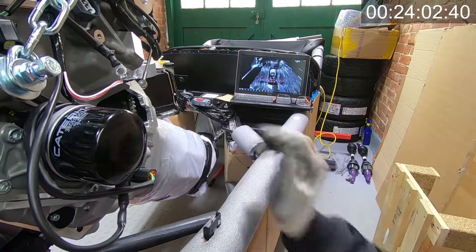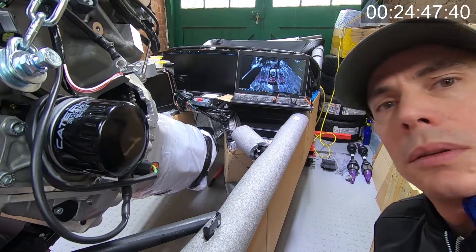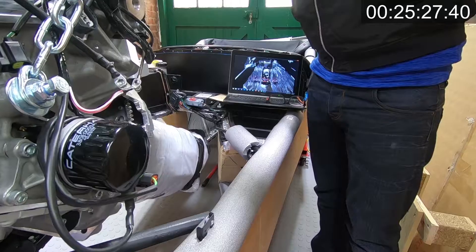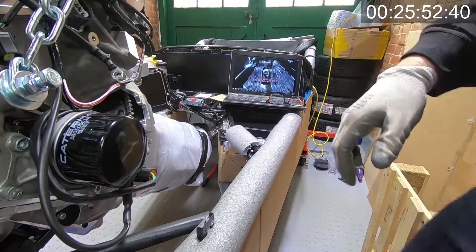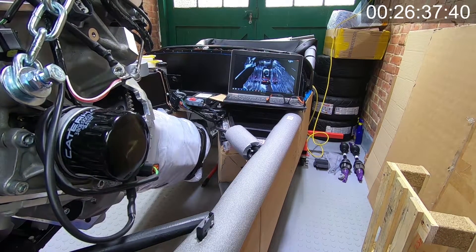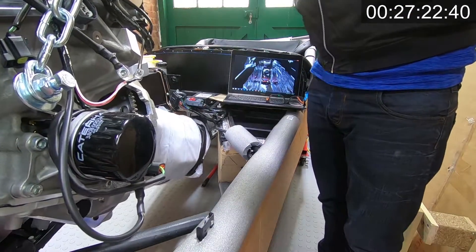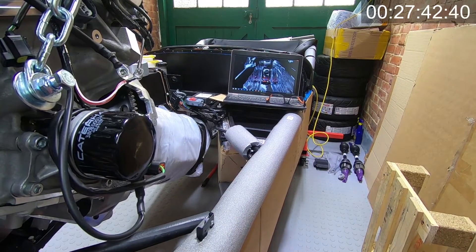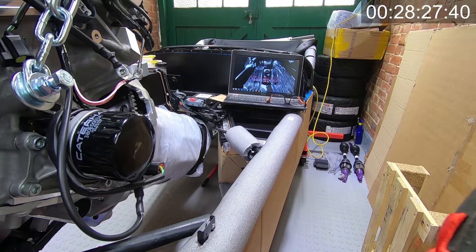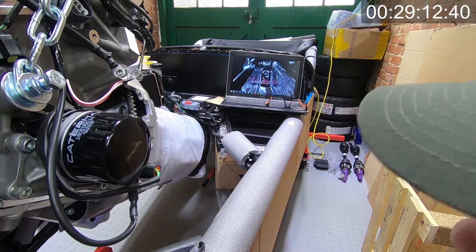In my case, rather than pushing the engine into the tunnel, I was using the ratchet strap to pull the chassis closer. During this time there are two points to watch: first, the gap between the gearbox and the top of the tunnel where the ECU is located, and second, the gap between the front of the engine sump and the top chassis rails which form the cross section. You can't just load it in at 45 degrees and level it out, because depending on the height of the axle stands there isn't enough room between the chassis and the garage floor. There's also a cross member along the bottom of the tunnel and the tail end of the gearbox needs to go above this.